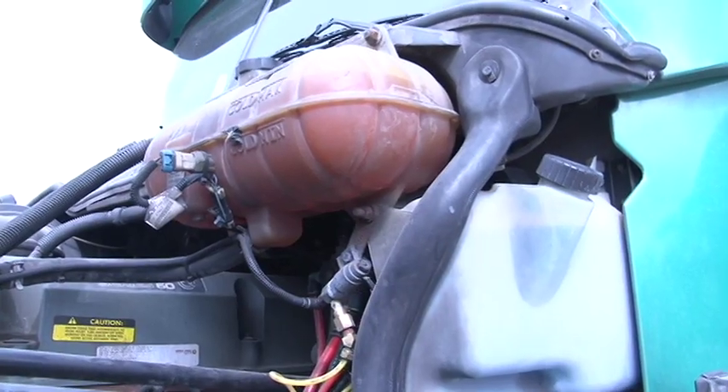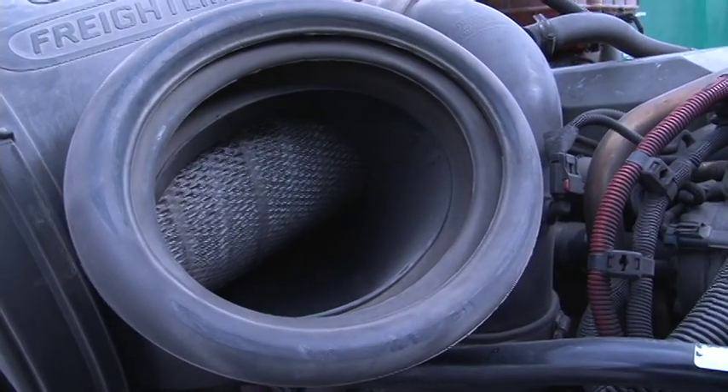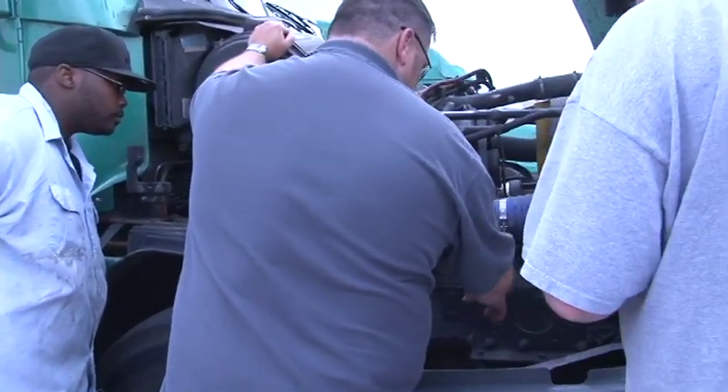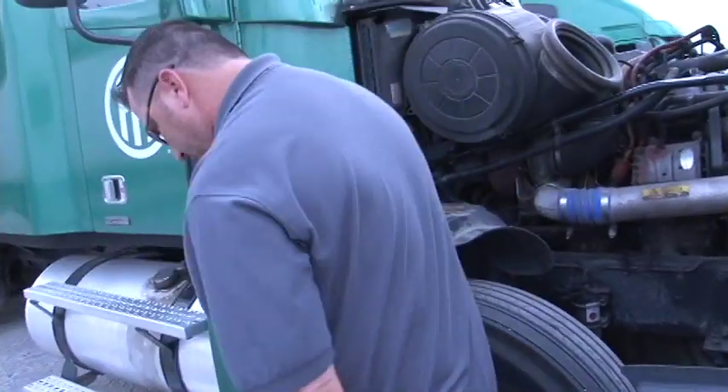What are we looking for over here? I'm looking at the brakes as well — brakes and steer tire. If you start to see paint chipping away, you know these bolts and cracks mean this metal has got some cracks in it. Also check your frame — same thing.